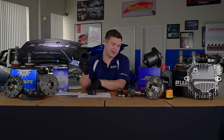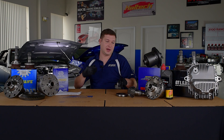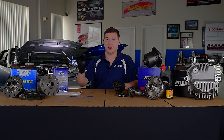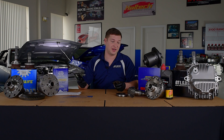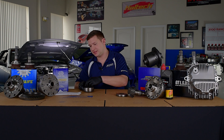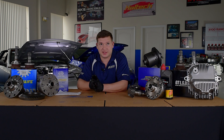As the goop gets hot, it gets thinner and performance goes really erratic. If you've driven your car for a sustained amount of time with a viscous LSD, you probably noticed it starts acting like it opened up. It was cornering and behaving like you wanted, but as you exit corners, it's just burning the inside wheel and letting you down. These things wear out. They're not serviceable — when you change the oil in your diff, the viscous fluid doesn't get changed. It's an easy and affordable method for Nissan, but it really leaves a lot to be desired.